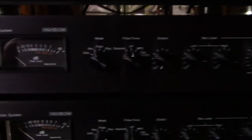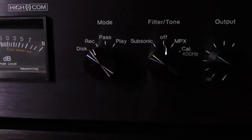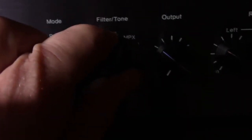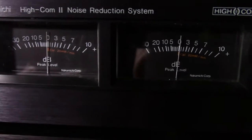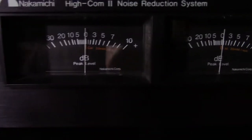What I'm going to do to begin this little demonstration is turn it on into record and press the record button. Then it goes to source mode. I'm going to turn the Nakamichi — here is the Nakamichi — and I'm going to set it to the cal tone, 400 hertz. You just turn it like so to 400 hertz, and you see now the meter is showing the cal tone, and it shows at zero. That's where the cal tone is supposed to be — on zero.